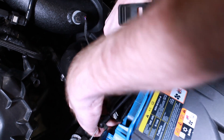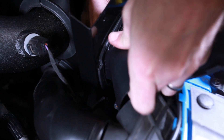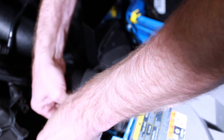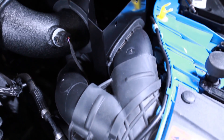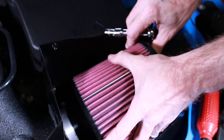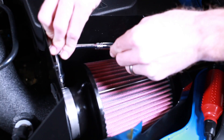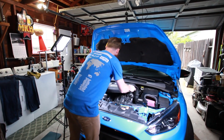It makes a nice snug, secure fit. Taking that rubberized piece, I'm going to reinstall it like it came from the factory — put this piece down in there as well so we have the intake ducting to the front. Now we just need to seal this up — it's a tight fit but that's the point. It seals up and gives a nice good connection into the air box. Go ahead and take the Mishimoto lifetime warranty, made in the USA air filter and install that — that's an eight millimeter socket in case you guys are wondering.